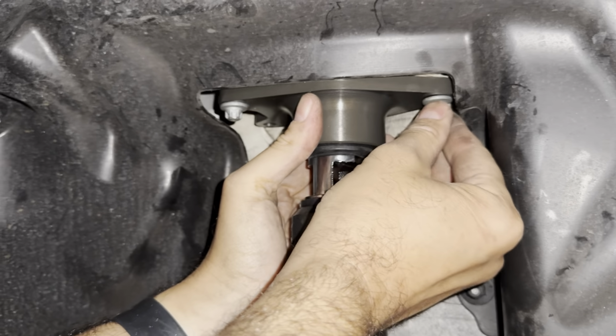So what I've done, I've got this spring really loose because we'll be adjusting that shortly. I'm gonna make it a bit shorter. And I got the jack underneath here, my tape kind of jammed up here. So I'm going to be jacking this hub up until it kind of starts lifting the car. And that'll give me a pretty good indication of where we need to be with that shock length. That way we can adjust the spring to get the preload. So the specs from Shockworks for the rear says we want 50 mil of droop. So right now we're at full hang and we want 5 mil of preload in the spring.